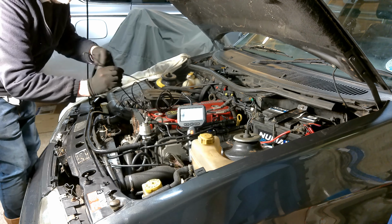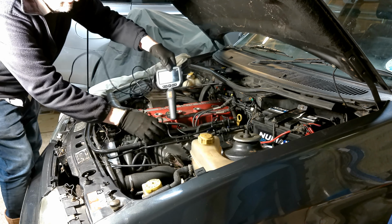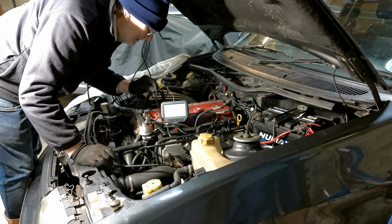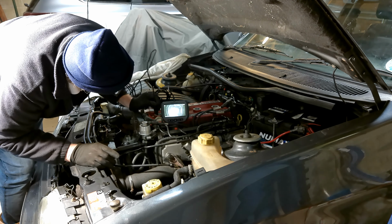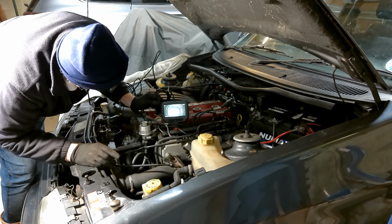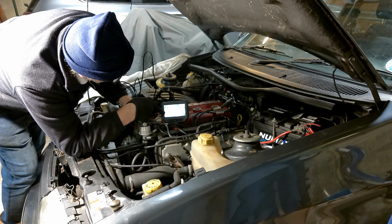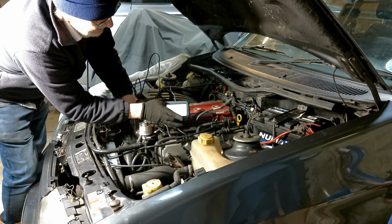Alright, let's go down the first plug hole. Oops. That's going to be some of the trouble here, so can't really mount it. How about that? That looks good, doesn't it? We're going down here. I see the top of the piston. That looks good. Hang on. I think I can see a couple of marks. I don't know if you can see. There's one there, and there's another one there. So obviously the valves have been hitting the piston, which ain't good. Okay, so if I press that.